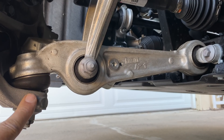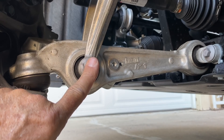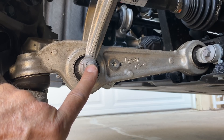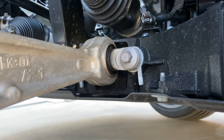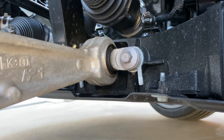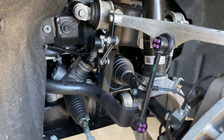This is the rearmost of the two lower ball joints in the front suspension. This is the lateral link, and the spring-shock assembly bolts here — the fork envelops the drive axle and the link itself, mounting at about 75% out from the pivot point, so that's our motion ratio. This is the inner pivot attachment point for the front lateral arm at the bottom, and you can see this shim. There's one on the other side too — the shims are there to make alignment adjustments. This is the stabilizer bar, and its link connects to the upper control arm, which is unusual — it's about halfway out from the pivot point to the ball joint.